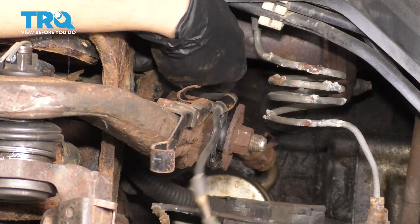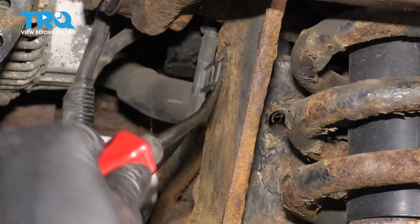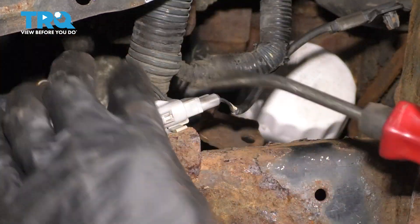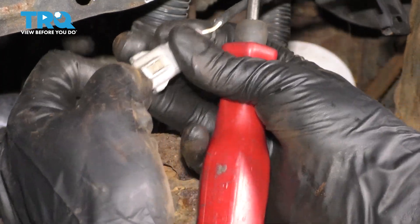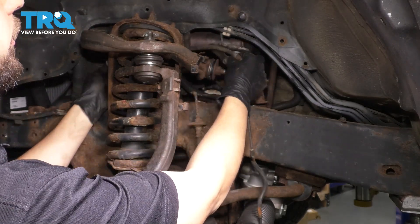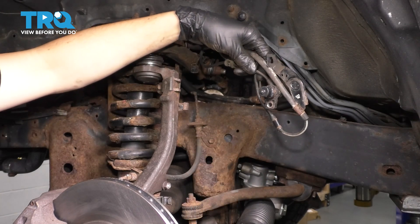At the back here, it's supposed to be secured on another one — mine is already broken free, so we'll leave that attached. Swing over to the front and unclip it from over here. Finally, the electrical connector all the way at the front — pop that out. A lot of times these are gonna be stuck because of sand, so shake it out. Now you just want to fish the sensor wire from behind the strut tower. There it is — there's your ABS sensor.